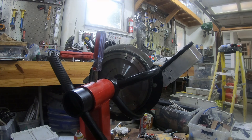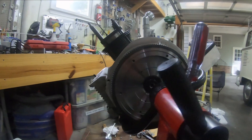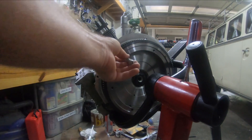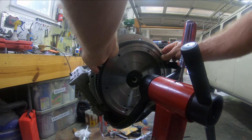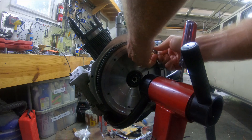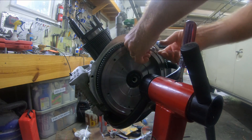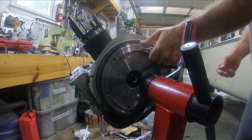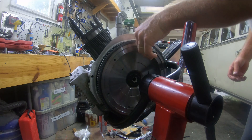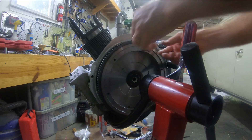I have another main seal coming because I had to take it out once and put it back on, and I'm not sure how well it's going to seal. My end play measuring technique was to put the screw in here, push it all the way in — and this is not the best way to do it compared to using a dial gauge.